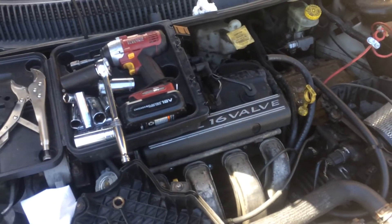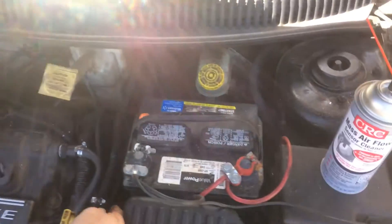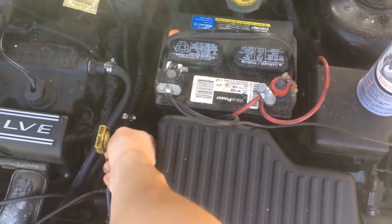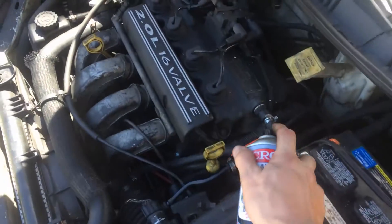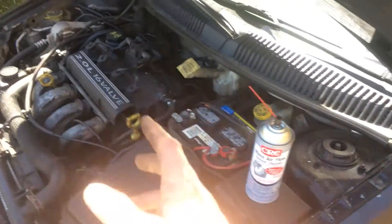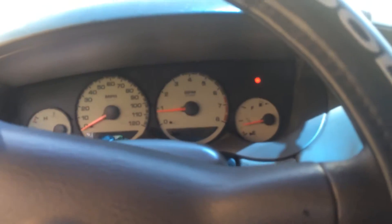Alright, thank you for watching. Got everything put back together. The clamps actually shortened the hose that was here, and I put a 5/8 hose on it — it worked out good. Cleaned all the hoses — there are two in here — spread that out, got all the junk out. She's running 10 times smoother. Definitely idling a whole lot better, which is definitely good.